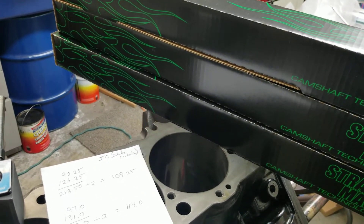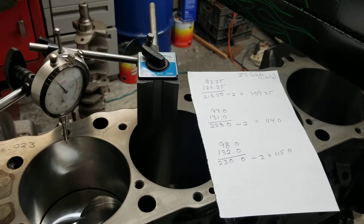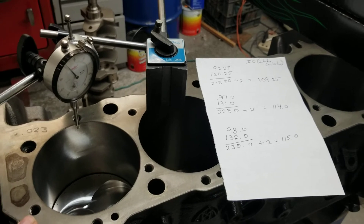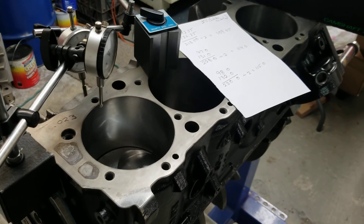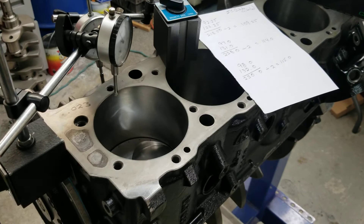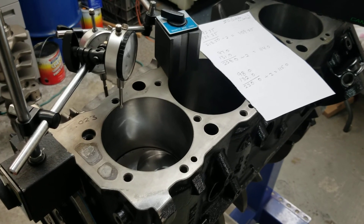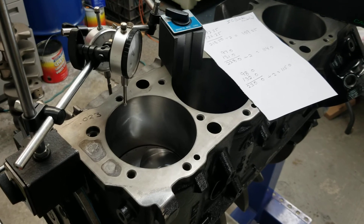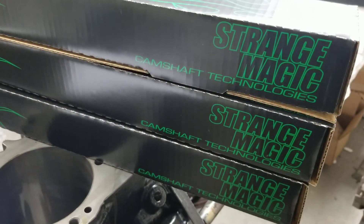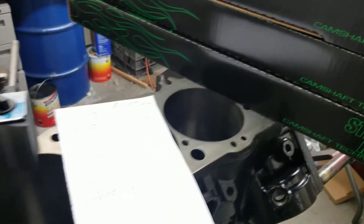We plot the intake and exhaust lobes out — we do all the plotting work for our customers. It's really the brains behind how well your camshaft is going to perform in your engine, not necessarily the one who's grinding. Hook up with someone that knows engine design — it will make a world of difference. What's really important is not only your exhaust lobe events for scavenging, but your intake lobe events which provide your cylinder pressure. If your cylinder pressure is off, your motor is not going to perform well. Anyway, thanks for tuning in. You can reach us at 1-800-382-1320 for camshafts, technical assistance with lobe plotting, or engine design. Like and share — tell your friends about Olds Performance and Machine. Thank you.